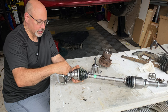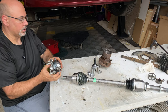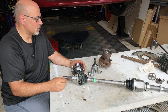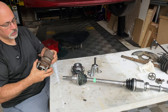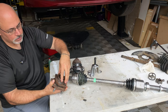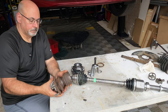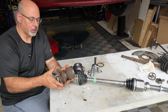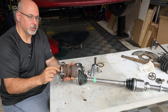For about $20, you might want to get one of these axle pullers so you can get this apart without hammering like crazy. When you hammer on a stuck axle, you're forcing the inner part through the bearings and could cause damage. The factory manual is pretty specific — don't wail on that. So, axle click versus CV axle noise. Applying Molykote like the service bulletin suggests will help. The Tesla spec calls for something like 200 foot-pounds, which will definitely help with the click, but if you do hear it, it's a sign that excessive play is occurring or the nut needs to be properly torqued down.